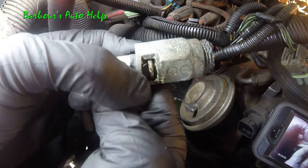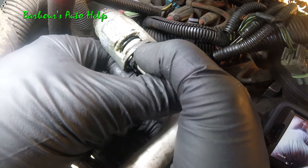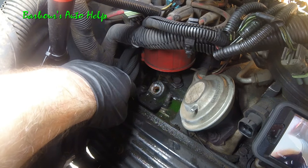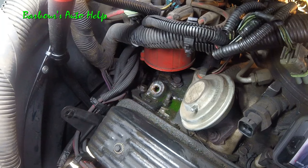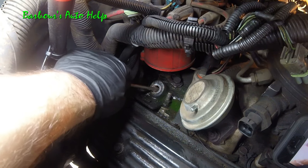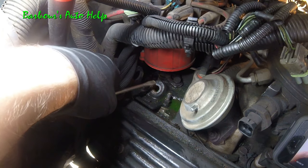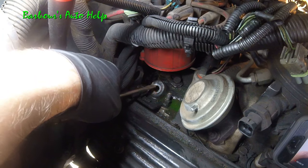You can see this little tang right here — get a screwdriver up in there and get it pushed in enough to get it off. It's just locked in by those little ribs right there, and this pulls right off. Before you get into this, make sure it's nice and clean around there — no dirt, leaves, or debris that might fall into that hole. Take your screwdriver and try to scrape all this loose debris up and out of the intake manifold so that it doesn't go inside. You want to avoid as much as possible getting debris inside the intake manifold, because you don't want that going through your system and clogging things up.